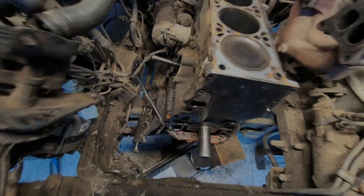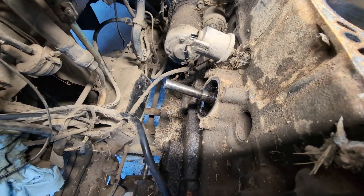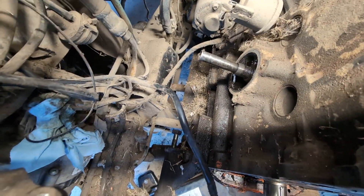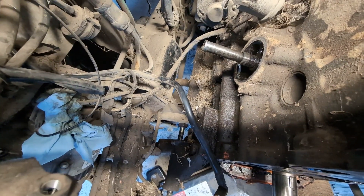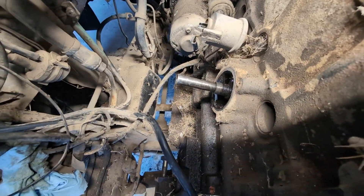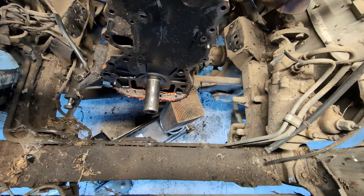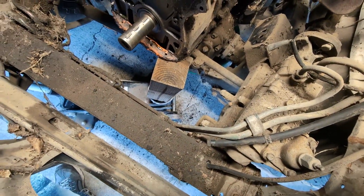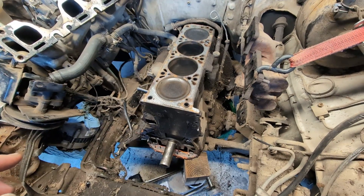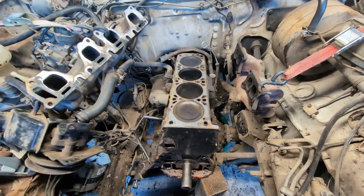Making some progress — pulled off the oil filter, disconnected the battery cable to the starter, unplugged the oil pressure sender, disconnected a couple of wires, pulled out the engine mount. When I took the engine mount loose on this side, the engine shifted and sat down, kind of wedging the oil sender against the top of it. Because it still has the transmission bolted up, I have a block of wood on the floor jack supporting the front of the engine. I won't undo the bell housing bolts that free up the engine until the hoist is connected for safety.